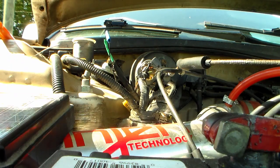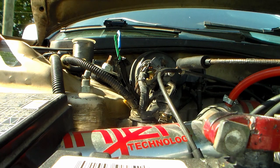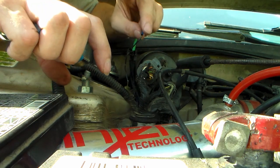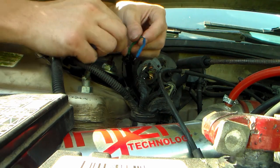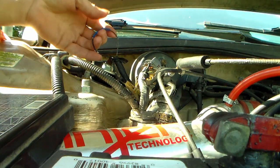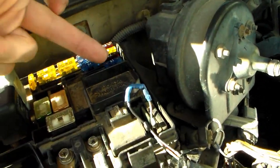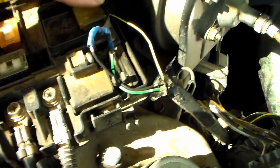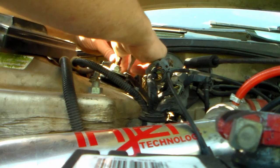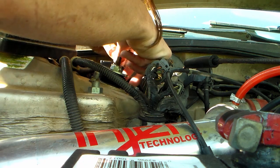Could use the soldering iron to heat the shrink tubing, but I like using a lighter. I've got to be careful — it is windy here. There we go — that's all heat shrank. This green stuff is not going to do us any good so we can take that off. We have our resistor on, that's the bypass done. That's a pretty good spot for it and it'll tuck down in here. I'll just tuck the old plug off somewhere, maybe run it to this little hole here. So that's what we look like when we're done — we feed this connector up here in the little box, and we'll route the bypass wires down in this little holder here.